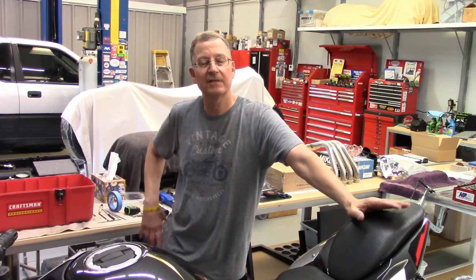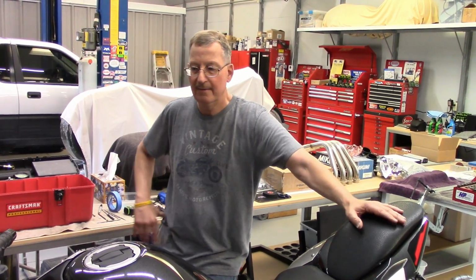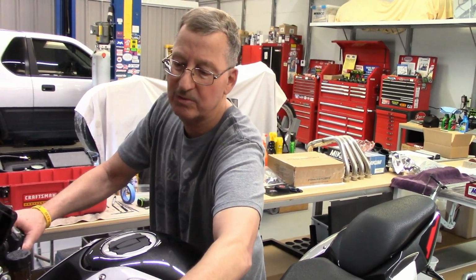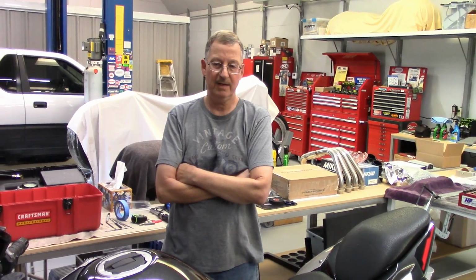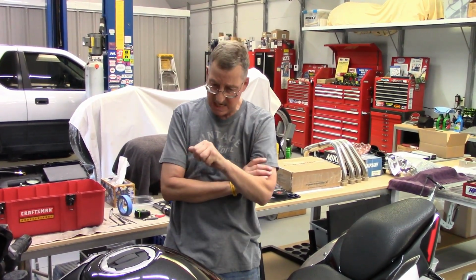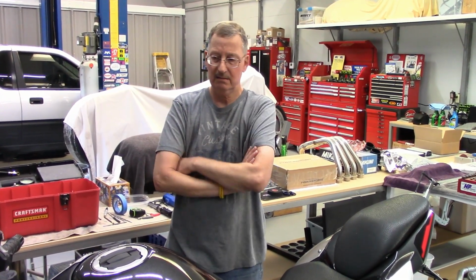I'm going to have to still get used to the clutch, so a couple are probably going to be throwaway runs. The lever pull is still pretty stiff, even with 3 stock H2 springs and 3 of Brock's. But I think I can do it. When I put all his springs in it, oh my God, there's no way I could let it out smooth. But I should be okay.